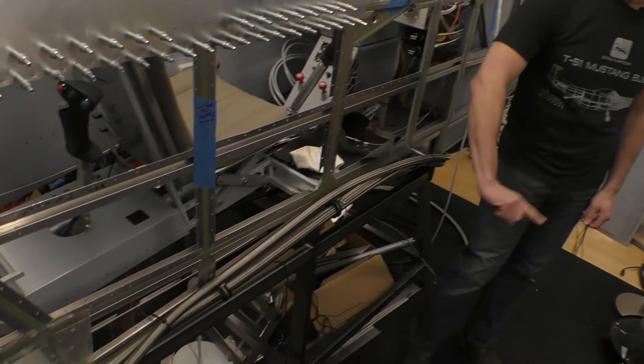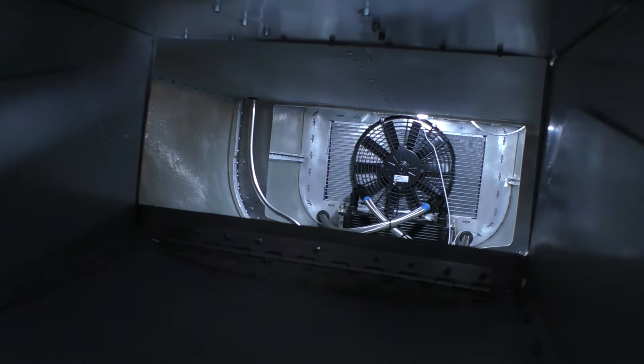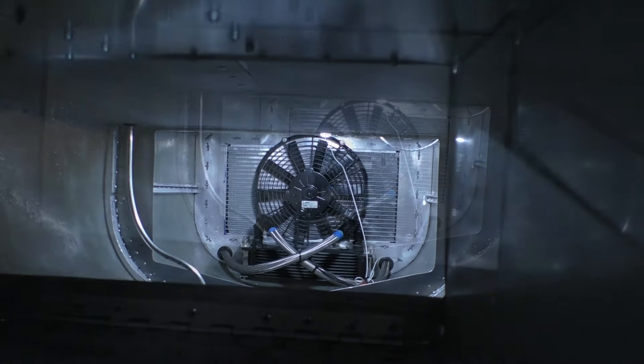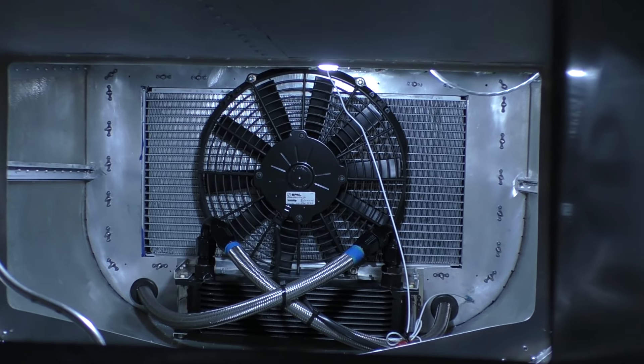Let's do a little tour of some of the work that we did. The first thing is hard for the camera to get down to, but we showed it in one of the videos — down underneath here we have the entire oil cooler area, and we'll show a little bit of footage of that. That was really cool because we had to do the oil cooler as well as the radiator, route the lines and get them up around the wing fairing area. That was my first project. By far the easiest compared to what we did, but I learned a lot about fittings and routing all the lines and making sure the lines don't fall off the plane.